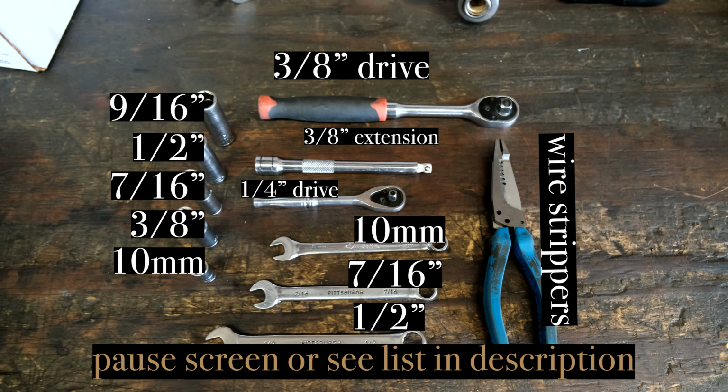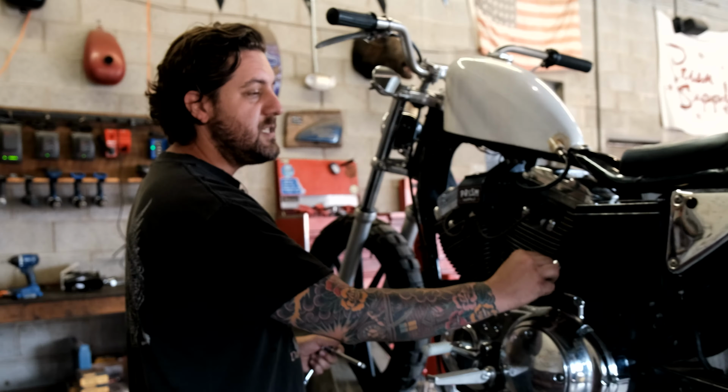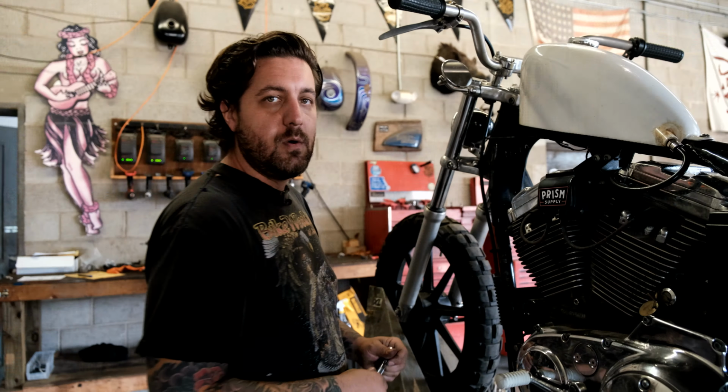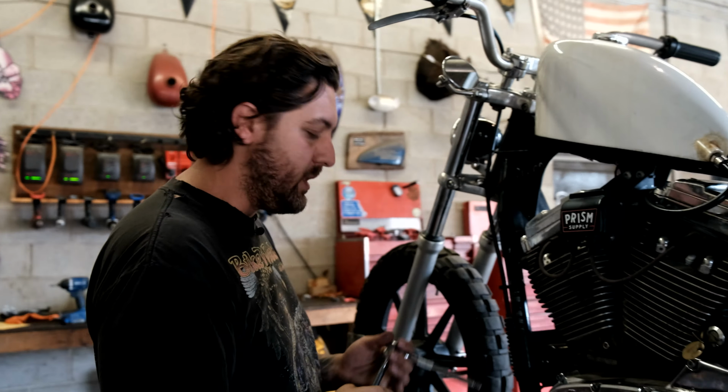Now we're gonna install this on Matt's bike. He's behind the camera right now. First thing you wanna do is disconnect the battery because you're working with electronics. I've already went ahead and did that. And then we're gonna remove the key switch and the coil wherever it's located, whether it's located here or under here. You're gonna take it off the bike completely.